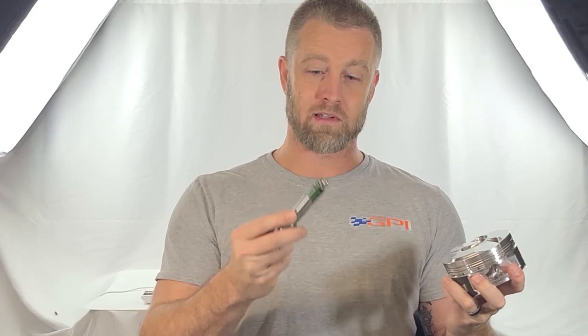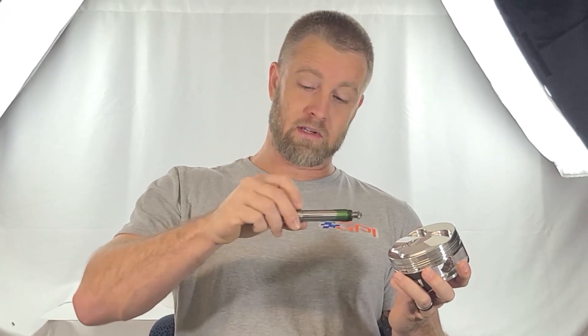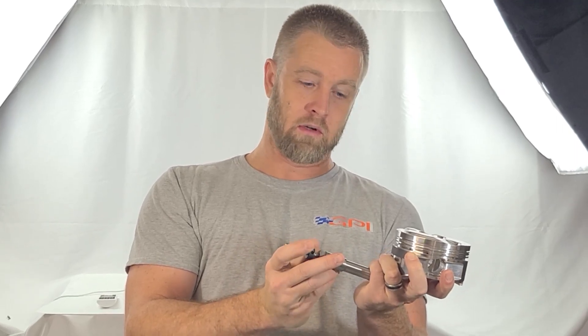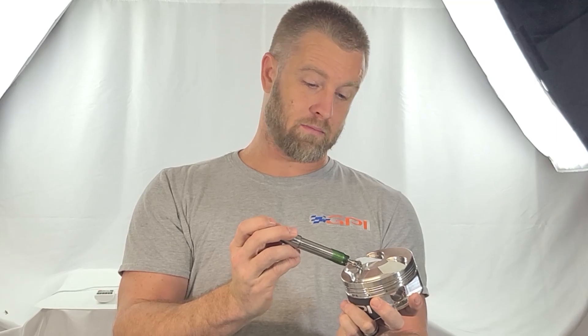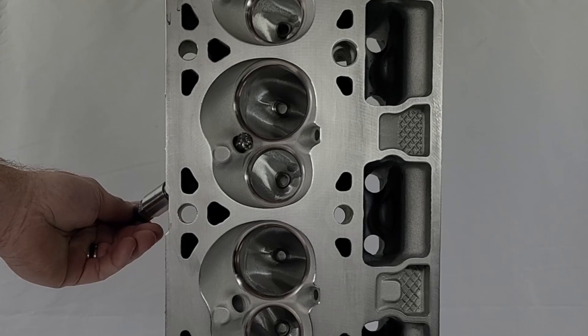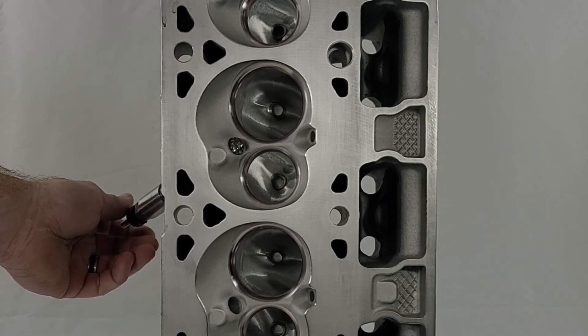There's a fly-cutting tool — or similar to a fly-cutting tool — made by Lindy that will give you spark plug clearance, and it's really simple to use. If you have interference, this tool screws into the spark plug hole, and you simply use the lock collar to set your depth on how much you want to cut — 30, 40, 50 thousandths. You're not going to remove much material or add much volume to your overall package just by putting a little spark plug tip relief in there. Also consider whether your combination needs an extended tip plug — you can run a non-extended tip plug as well.